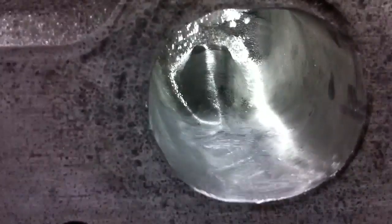Going back as far as I can reach. All I did was polish that lump that's right there from the water jacket — the lump's right there. All I did was just take off the rough cast; I didn't take down the lump at all. I'm going in here and smoothing out as far back as the short mandrel will reach.